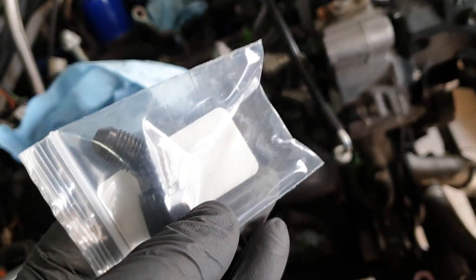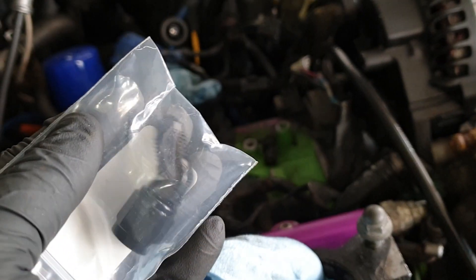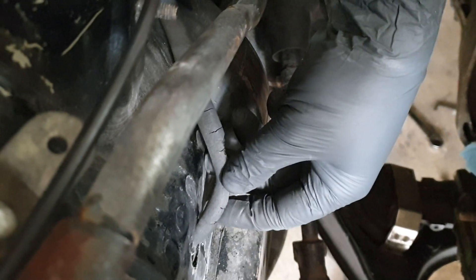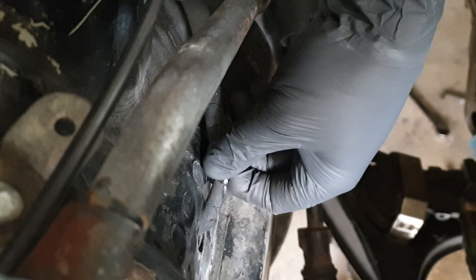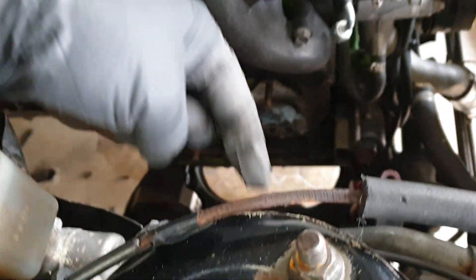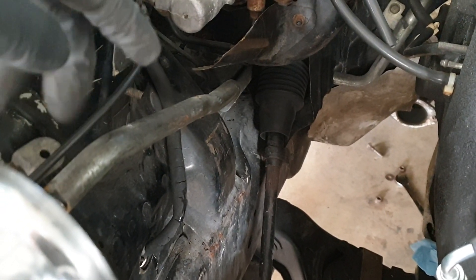So I ordered a new 45-degree fitting. Because right now, if you saw it in the past video, I only had a fitting that goes in the block. So with this fitting, I hope that it will be perfect — it's gonna push it up a little bit and to this side. I also realized that the ABS line is really too close to the turbo and turbo manifold, and it's a little brittle and kind of melted as well. So I'm gonna see if I can route it in a different location, because I found a hole here that goes out from underneath the fender.